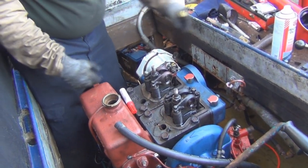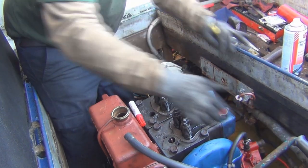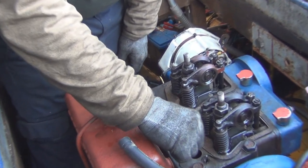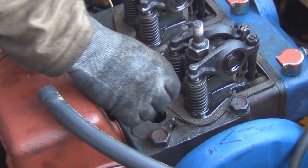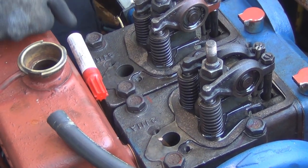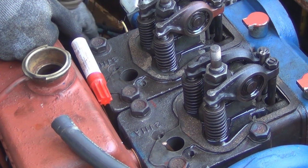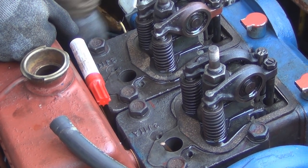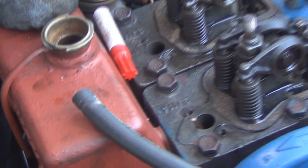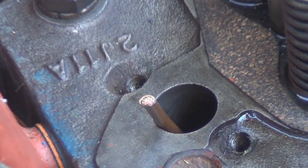You are now going to set the valves? I will do in a second when I've got TDC. That's dropping - you're using the wire. Just a piece of wire down the bore for the injector. Sit it on top. So that's actually touching the top of the piston - touching the piston crown. And then it's just a case of, with a screwdriver, moving the flywheel along. That little piece of wire then is just my gauge to see when it's on TDC.